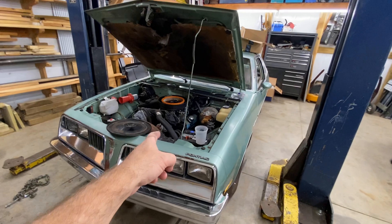Here is the transmission for the new hot rod high school car — Turbo 350. We're upgrading to a 200-4R, so I'll have overdrive for Power Tour. We took it apart and it's super clean. Even had a new transmission mount on it. The 200-4R has a 0.67 overdrive — that'll help. Making progress. Transmission is nice and clean.